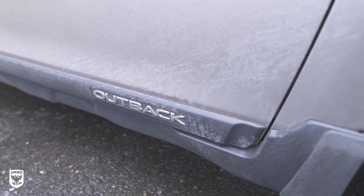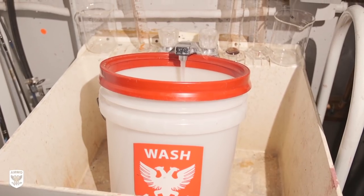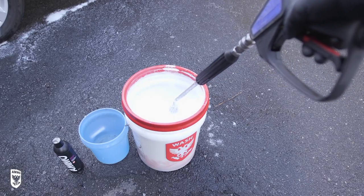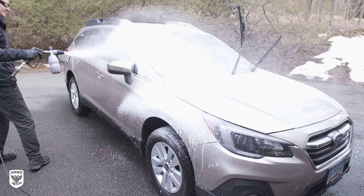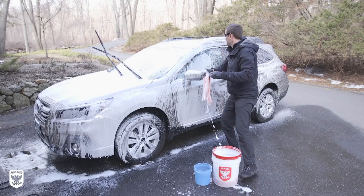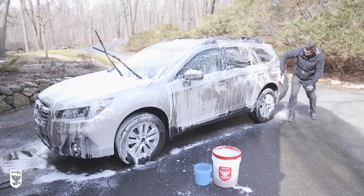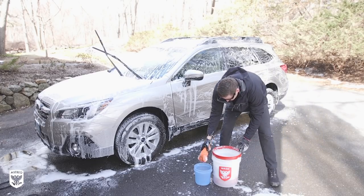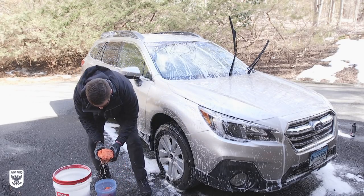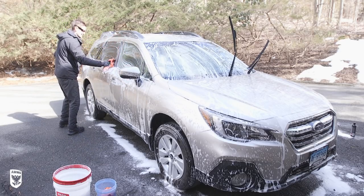Process flow number five is the paint. First, spray the car with a power washer, hose, or hoseless aerator to remove the majority of the dirt. Then fill a bucket half full with warm water and add a few squirts of boost. Next, add four or five towels to the water and agitate to create suds. If available, foam gun the paint or use the aerator to apply the first layer of soap and winter boost. Allow to dwell for one to two minutes. Then remove one towel from your bucket, fold it into fours, and wipe the paint working from top to bottom. Be sure to refold the towel as it becomes dirty. Once all sides are dirty, wring it out, place it in your dirty catch bucket, and start with a fresh towel. Repeat until all painted surfaces are cleaned, never re-dunking your towel into the original boost mixture again.